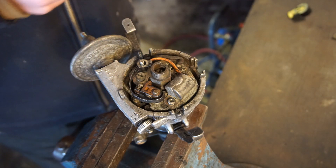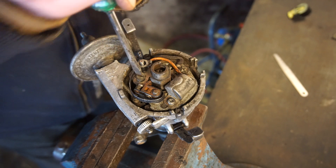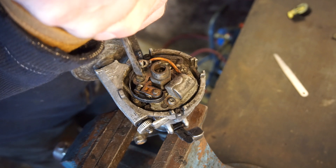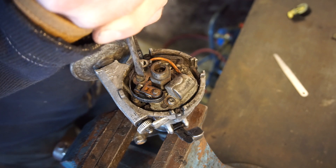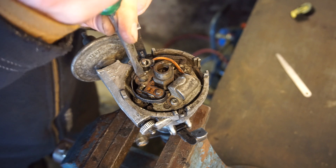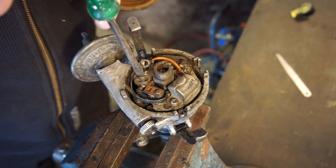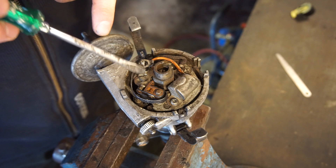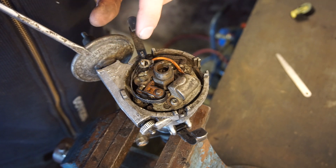Normally I probably wouldn't do anything about this - this would be just fine. But I'm going to show you how to adjust them. So you have a screw here which you can loosen. Some gentle taps with a hammer and this thing loosened up. It really shouldn't be too tight - of course you don't want things to move, but still you should be able to get it off. So if I get new points, I'll probably get a new screw here as well. As you can see when I opened it up, the points closed up right away.